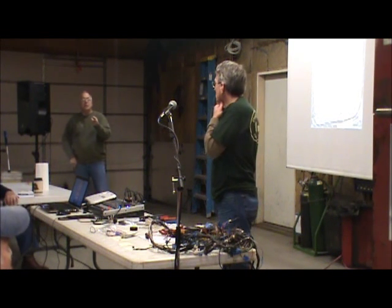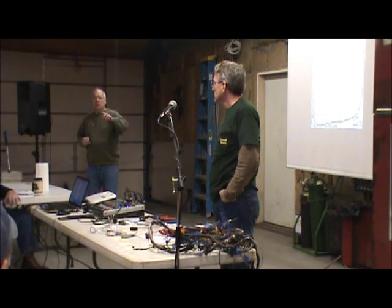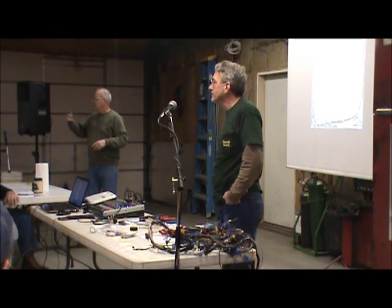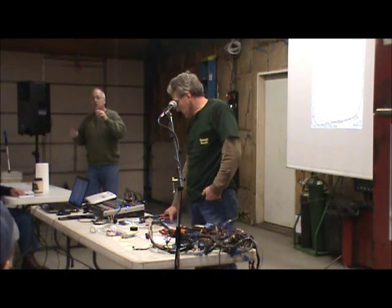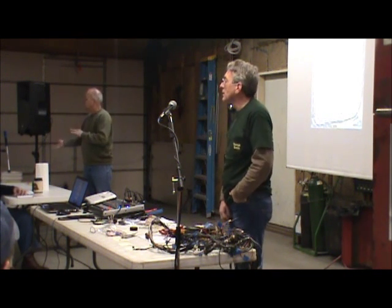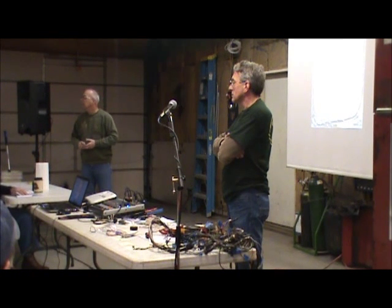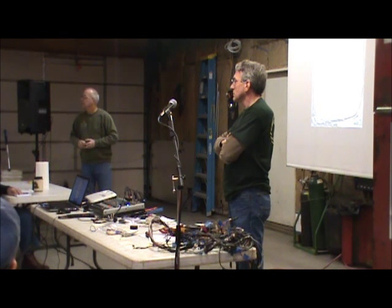I think something about the dielectric grease that's different from the lithium grease is that it doesn't necessarily migrate like the lithium grease could. Depending on the temperature, wherever you're using it, lithium has a tendency to creep where the dielectric wouldn't creep, so to say. It accomplishes the same thing, it doesn't really matter, but I only use the dielectric now. The lithium was there from way back in '73. It's gotten actually sort of dry in there, even though it still protects, so when I take it out, I have to clean that off.